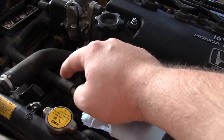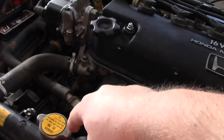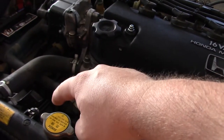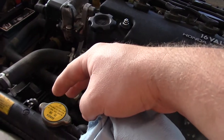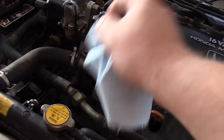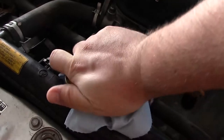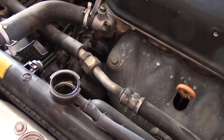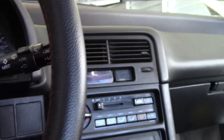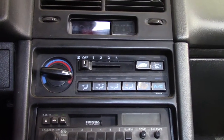When the car is running, the coolant system becomes pressurized. If you take off the cap while the coolant is hot, it'll blow off and take a bunch of scalding hot coolant with it, usually causing burns. Make sure it's cold before removing it. We take the cap off now because when draining coolant it would otherwise create a vacuum in the radiator, preventing it from draining.